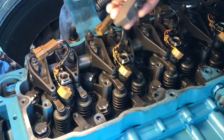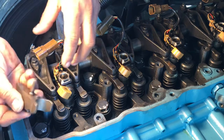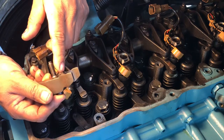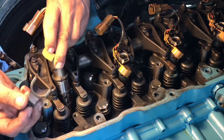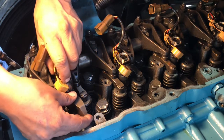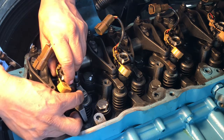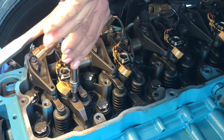We're going to take the little wishbone looking creature, and as you can see, it's got a little foot, a little catch here in the bottom. That little catch goes on this little slot that's cut into the injector. Basically, you slip this on, make sure it's in, bring it down, and then let the little foot take the injector in.